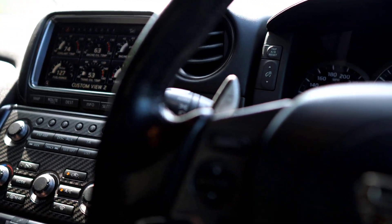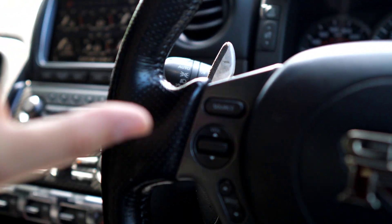We spoke about the bellhousing — as I said I'm going to let you hear it on this car. One thing to bear in mind is that stage 4 or stage 4.25 can exacerbate the bellhousing noise because of the lumpier idle. But as you can hear from the inside you can't really hear much at all, and from the outside it's fairly quiet. Really it's only a massive problem if it sounds like a ton of dinner plates rattling about really badly.